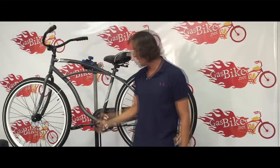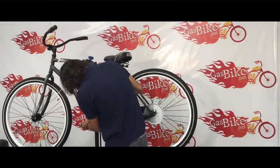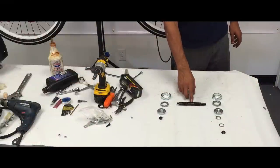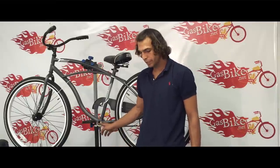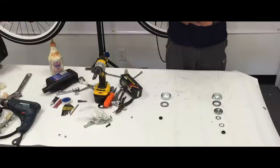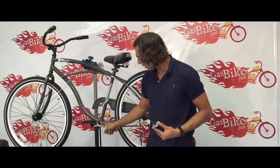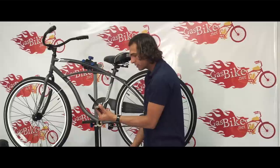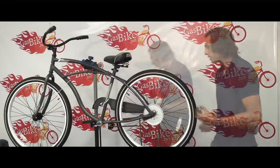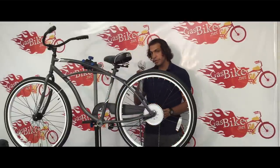Next we're going to install the three-piece crank system. The first step is to loosen these. Also you want to take off the pedals first. I'm going to take off this chain cover so I have more room. This is the centerpiece of the three-piece crank that we had to buy in order to install a three-piece system into this bike. You're going to put these pieces on one side, put the bearing on like that. It comes with bearing holders, but the bike already has them in there, so I'm just going to reuse these. Take this with the bearing loaded and put it straight through. Now take the other bearing and nut — put the bearing first, then the nut.